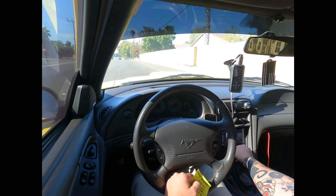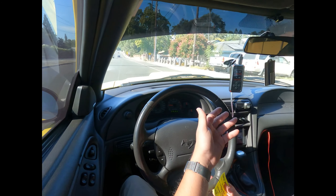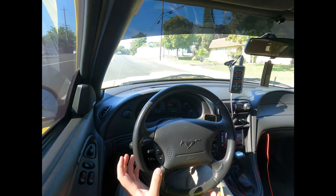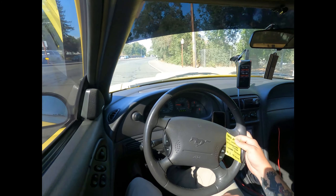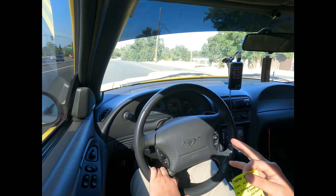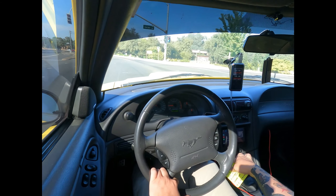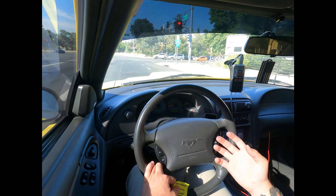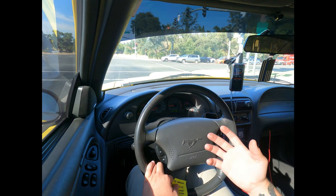With the 91 octane tune, you can't use a lower octane fuel rating than 91, but you can use 93 or 95 and so forth. I have the 93 octane tune available on my tuner, but since in California it's a little harder to come across 93 octane — unless I do octane booster at the pump — I'm just going to go with 91 for now to be safe. The only two base tunes offered from American Muscle are the 91 and 93 octane, but they do offer custom revisions if you add modifications like a camshaft, boost, or a bigger intake manifold.